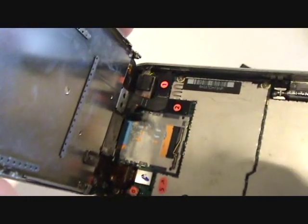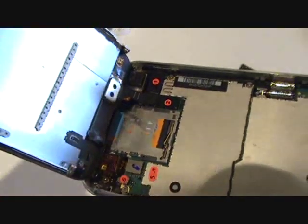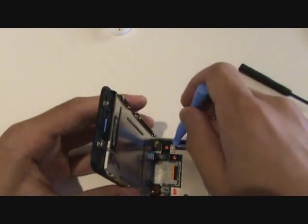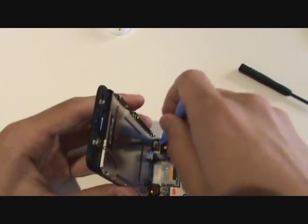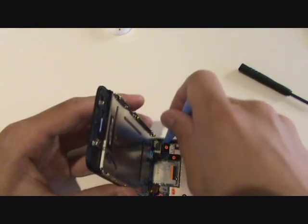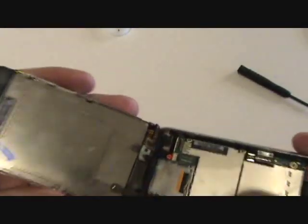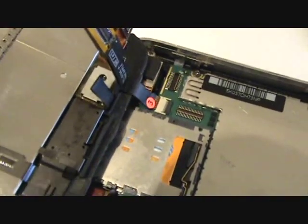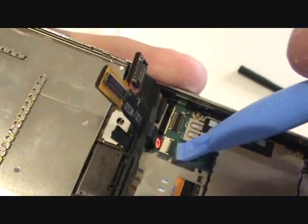So you open it up on an angle. These cables are actually numbered — you see one, two, and then underneath cable one there is cable three, which you will see in a second. We will remove these in order: one, two, and then three. We will use a case opener tool to unplug them from the logic board. Cables one and two just unplug, and then cable three is actually latched in place, so the black plastic clip needs to be lifted in the upward direction.